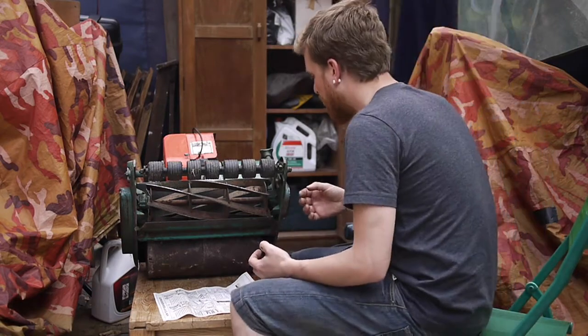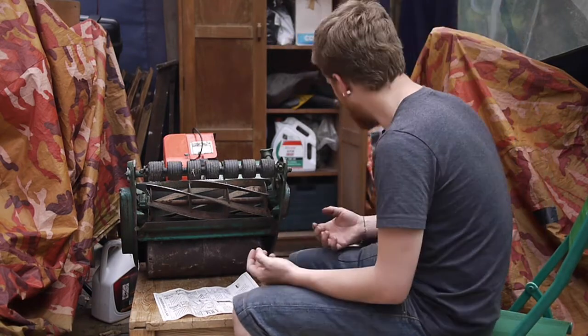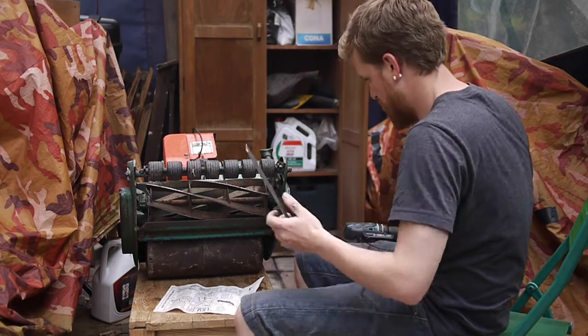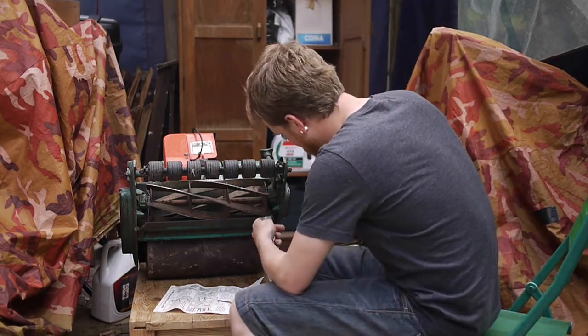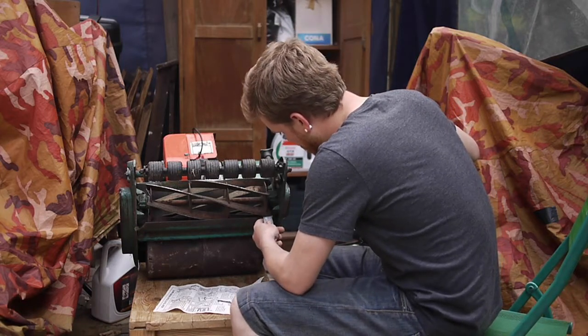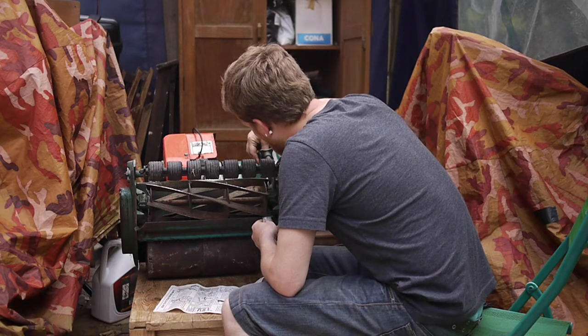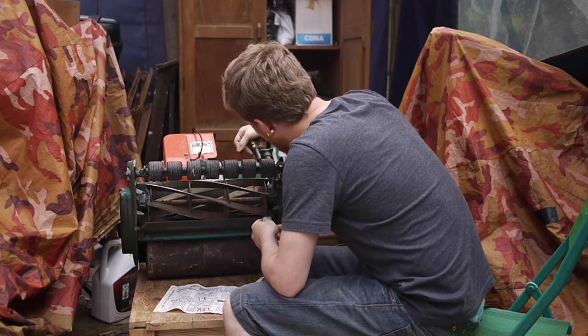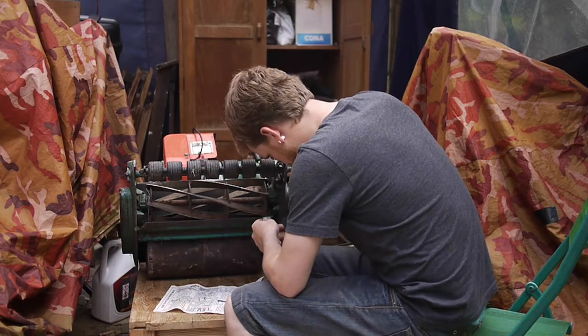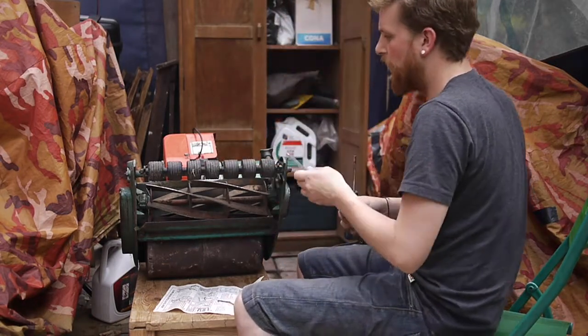State of our world is that I don't have many 2p pieces. We're going to average it out at 2 2p pieces being a total of 4 mm. Real measurement for real people. So what I'm going to do is I'm going to put the ruler on the bottom of this top blade, and I'm going to back the blade off using these adjustment screws. Four.